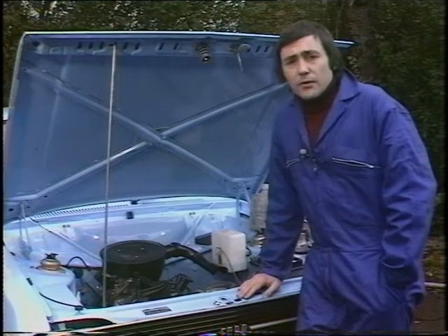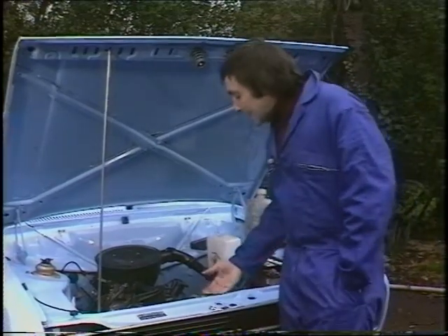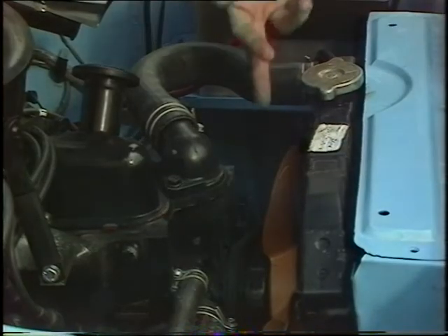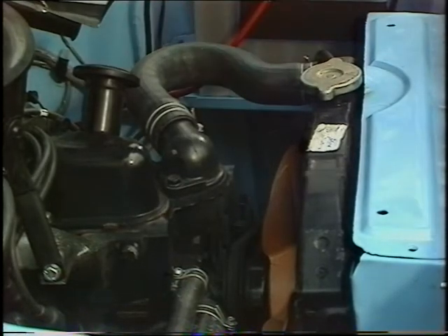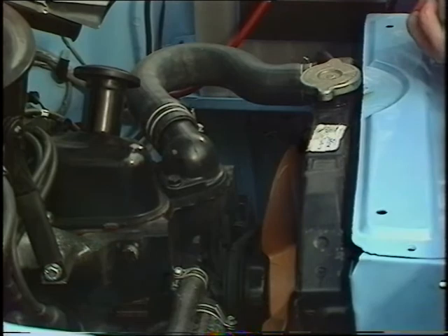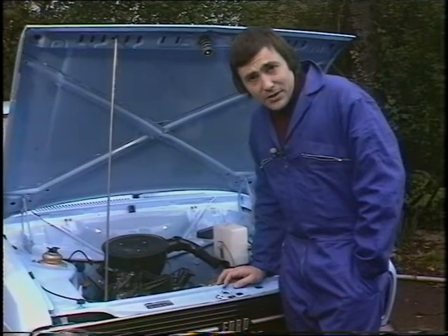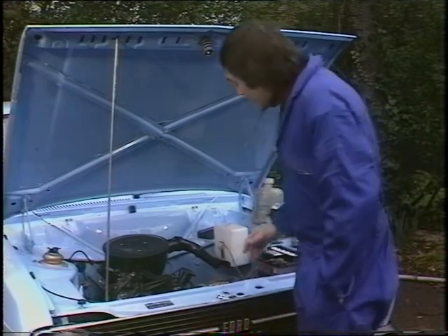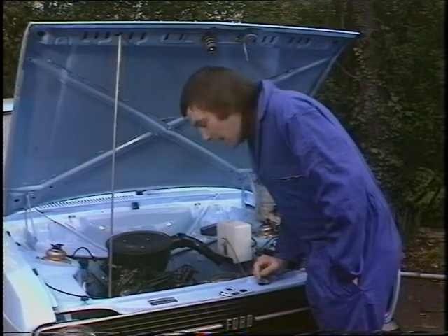Any item on overheating really only applies if your car has a water-cooled system, which means if it has a radiator holding coolant, assisted by a fan driven by a belt, and the coolant is pushed through hoses and then through the engine and into the heater. If it's got this kind of system, the first thing you should look for is the tension on the fan belt itself, because if that is slack, the fan won't be turning properly, or more likely the water pump won't be turning properly, and the whole thing will just be heating up merrily.